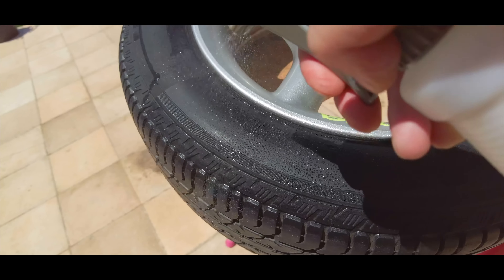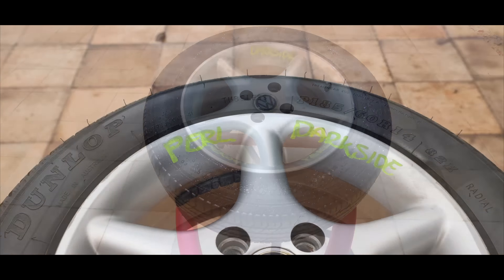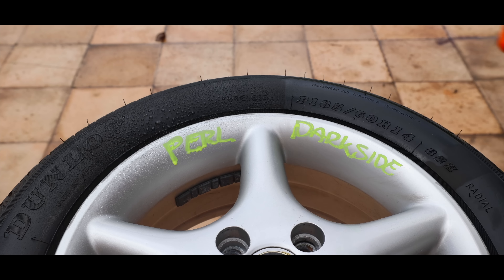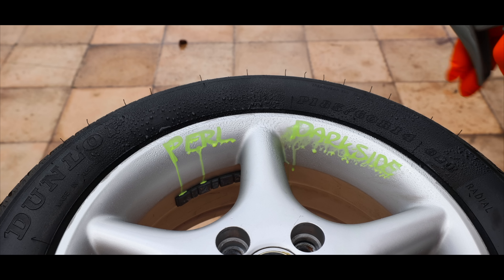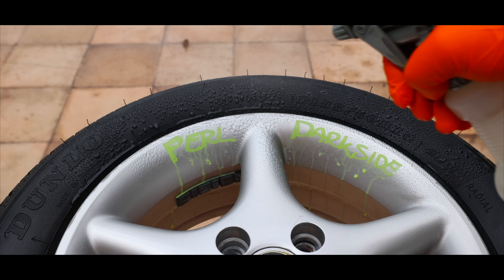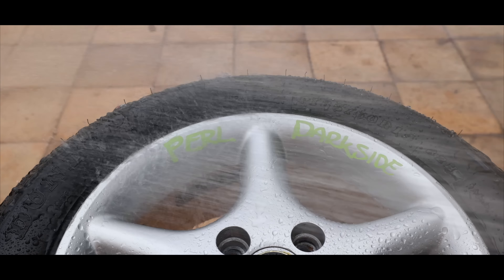Blackout on the other hand is extremely hydrophobic, and I'd say perhaps even a touch more than Darkside overall. On the second tyre where the dressings are sitting much thicker and weren't leveled down, Pearl and Darkside are both very hydrophobic and almost equally matched. That's because Pearl in this more abundant amount does in fact bead and sheet quite impressively. However, I don't think this is a good representation because most of that excess dressing can't effectively bond to the rubber — there's simply too much, so this increased hydrophobic behaviour will be short-lived. Whereas even after Darkside is leveled down to remove the excess, it still beads impressively, meaning it's a true representation of how it really performs.